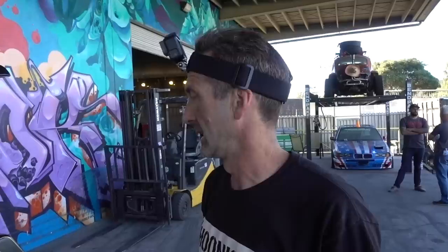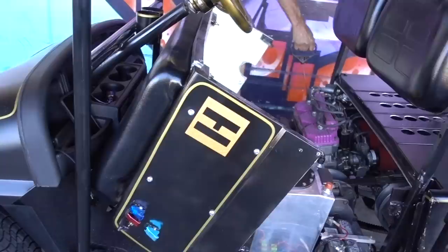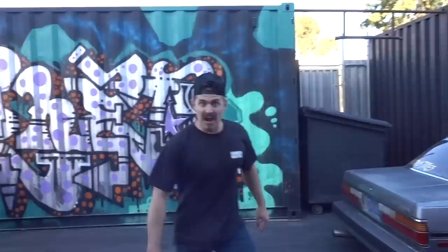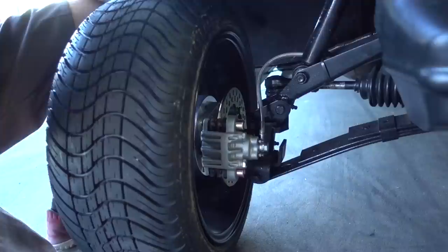What's the word, big guy? Now our biggest problem is full throttle. We're working on not stretching that cable and getting us to full throttle. Like I was telling you, I should have the kind that has the threads and the nut on both sides, like a throttle cable. Let me tighten this one more time and you can go through full throttle again, and then we'll take it for a spin. Something went wrong. I'll have to adjust that.